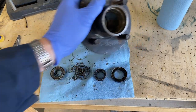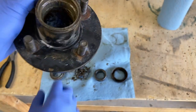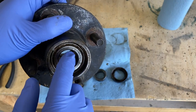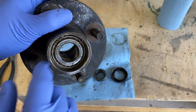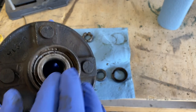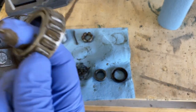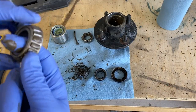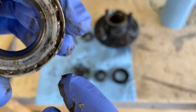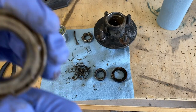The racer is this metal ring right here, sitting at an angle, and the bearing fits right in there. It's designed to mate with that racer perfectly — they come in a paired set, so if I replace one I'll replace the other. There's also one on the back side. We'll repack these bearings before we put them in, but now we have to measure them to find out what kind of bearings they are. I don't see any legible markings on them to tell me what size it is.